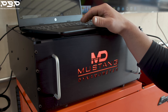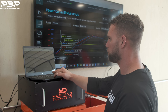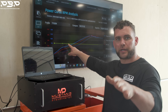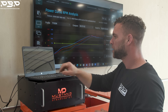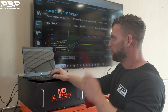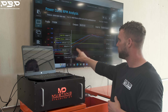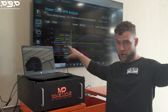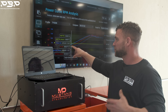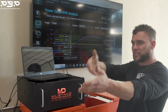We're going to compare what we just ran against the Mark 2. The bold line is the Mark 3 — what I just ran. The faint line is the Mark 2. You can see the gap between the two. Let's pick two places — let's go to 2,900 RPMs and compare. At 2,900, the Mark 2 exhaust manifold made 239 rear-wheel horsepower. The Mark 3 we just ran made 388 — roughly 150 more rear-wheel horsepower on our new manifold.